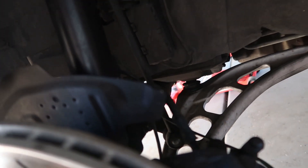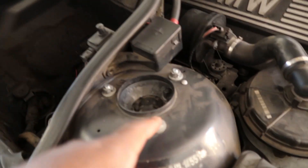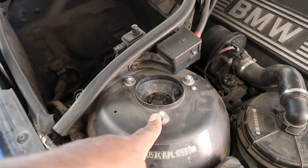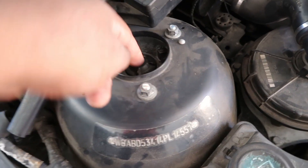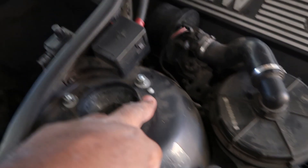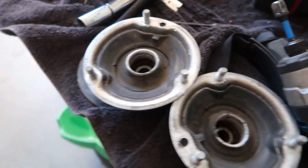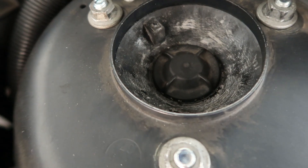Time to put the wheels back on and get it dragged down. We are all done — put these back on, I still gotta torque the lug nuts. Re-tighten these — remember these are 13mm. Made sure those are good and tight, shot these a couple more times with the gun. That's 21. Got the actual dowel that sits in there — I don't know if mine were just broken off or what, but there's none there and none there. See all the cracks in that old thing — and now no cracks. We are looking good.